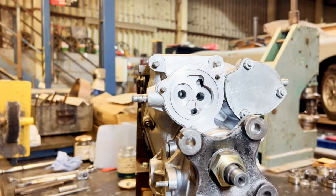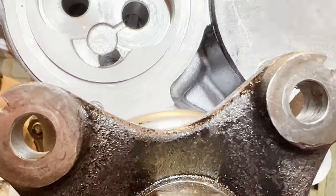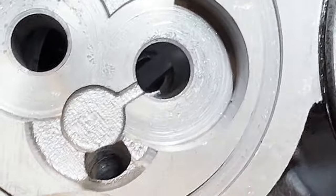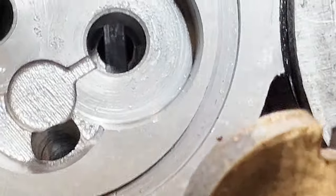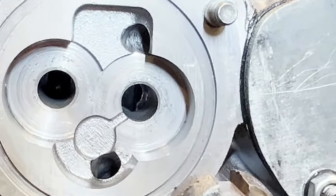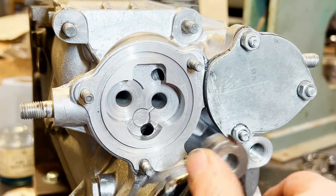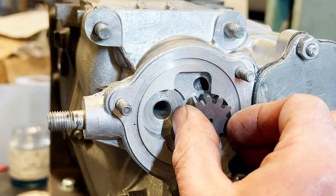So we'll fit the oil pump. You'll see the drive moving around in there - there you go, see that? That's what drives it - that peg running around, that dog drive. See it wouldn't go in there but turn it around and it'll pop in - see like that. The drive gear engages and that will drive the idler. I want a bit of oil on these really, just for the purposes of showing you how they work.